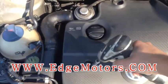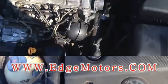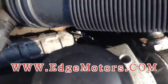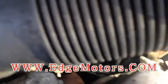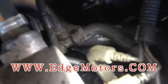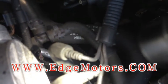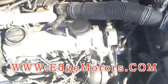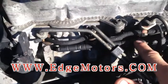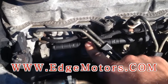Engine cover off. We check the coolant temperature sensor, which is right down there. See that wire over there — this is the coolant temp sensor. This thing is bad, it needs to be replaced. And here we've got the glow plug harness over here — this is the one that usually has the problems.